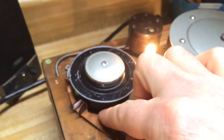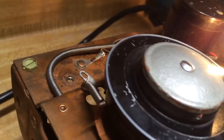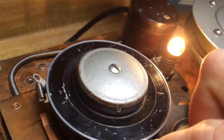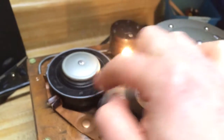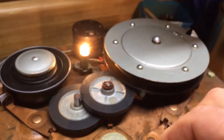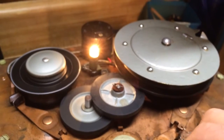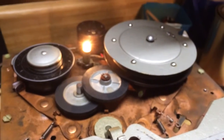I had to really lay off on these brakes. In fact, that spring that you see right there — I replaced that spring because it was too tight; it wouldn't allow this reel to turn. But by replacing those pads and the spring, it appears to have allowed it to play. And as you can hear, it plays rather nicely.